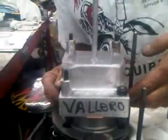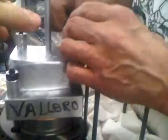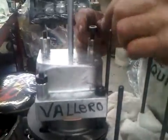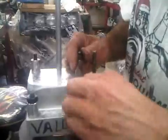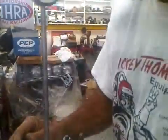So this is the difference between this fixture and what somebody else does — you're torquing them all evenly, mimicking a head, as opposed to just a bar that would go straight across the deck. By doing that you're only squashing a portion of the gasket, and you can actually damage the gasket or break a barrel sometimes. And you're not going to get an accurate reading — the reading will be off.